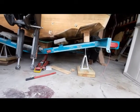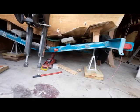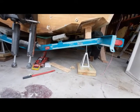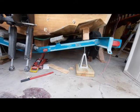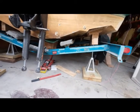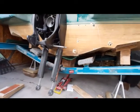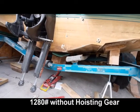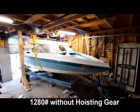To get the straps underneath, I jacked up the trailer axle with a floor jack and then put these little stands underneath. These are not good jack stands — they're designed for stabilizing trailers — but for what I'm doing they seem to be working okay. I put those under and then lowered the floor jack down onto those. A little scary, but it worked. My next step is to put some shims on top of the bunks except where the straps are, and lower it back down onto the bunks, just because I'd feel safer. I'm also going to leave the jack stands in place.